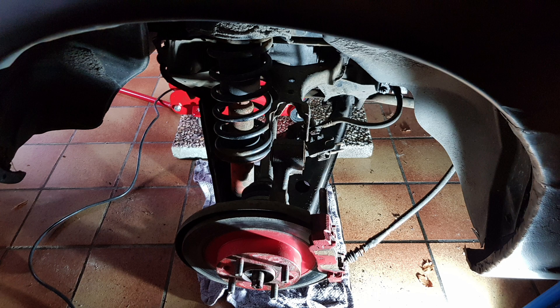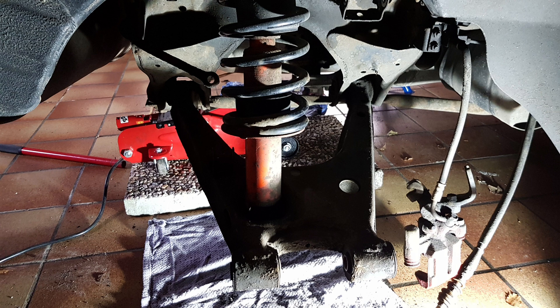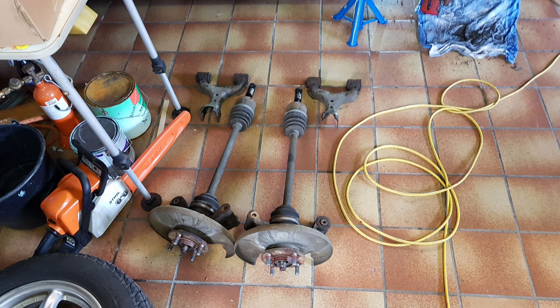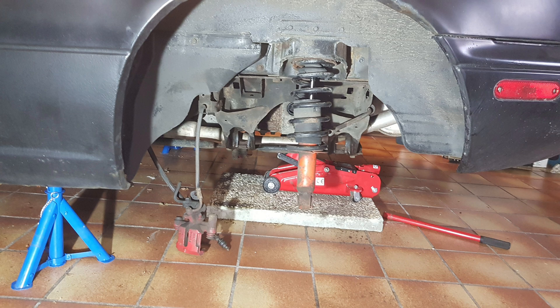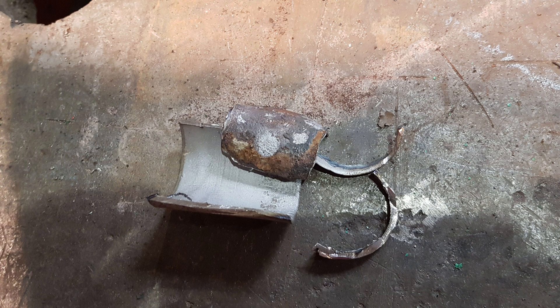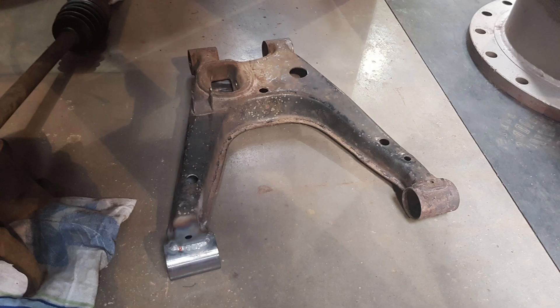I did both sides simultaneously and worked top to bottom. I decided to keep the shocks and sway bar to save some cost. I started with taking off the brakes, then the upper swing arms. The half shafts came out with the wheel hubs because I couldn't yet get them separated, and right after that the lower swing arms came off. During the process of pressing out the remains of the old bushings, one of the holders cracked, so a very experienced colleague of mine made an identical piece out of a thicker piece of pipe and welded it in. It was spot on.